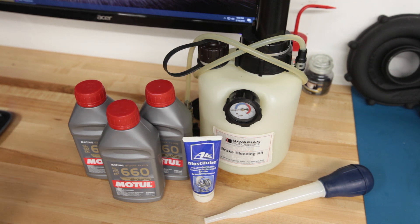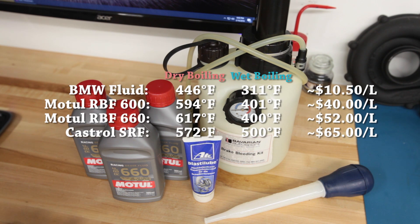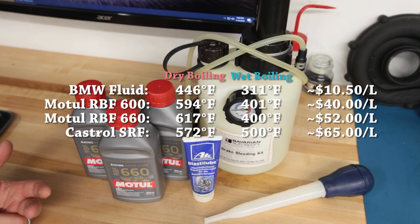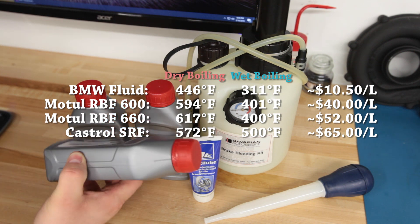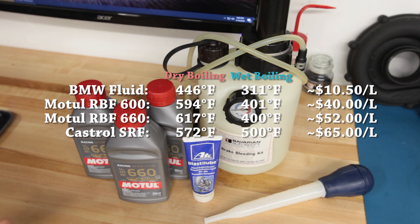When you go to a higher rated brake fluid, it's really talking about boiling points — there are two figures: the wet boiling point and the dry boiling point. Wet boiling point accounts for water content in the fluid and how that changes the boiling point; dry boiling point is 100% fluid with 0% water, so that figure is always higher. Because these high-performance fluids have such high wet boiling points, they recommend more frequent replacement since they're more sensitive to water content. BMW recommends replacing stock fluid once every two years; I would consider replacing high-performance fluid probably twice a year, and bleeding before and after each track day. That's maybe $20 twice a year — not a big deal.